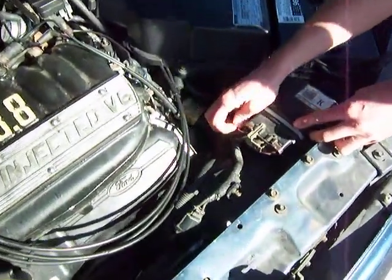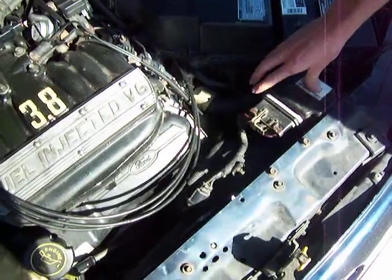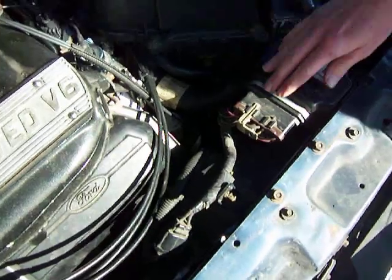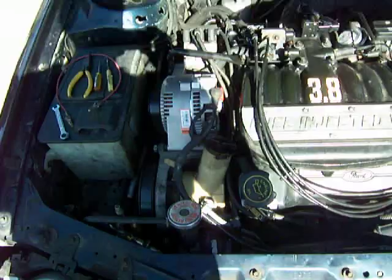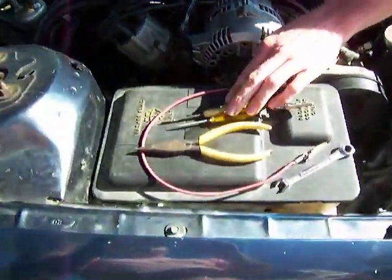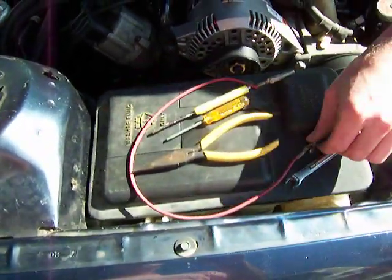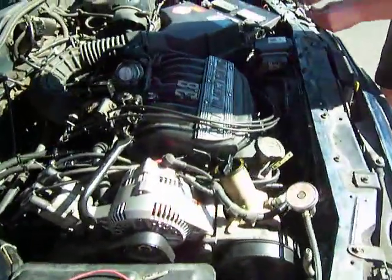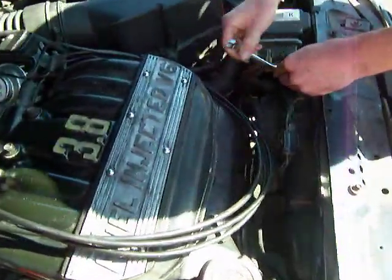To check this out, the power wire for the fuel pump should be a pink with a black stripe wire, which is this one right here. If you're in an emergency situation and need to bypass this, you're going to need some tools: two electrical screwdrivers with flat blades, needle nose pliers, a jumper wire, and an eight millimeter gear wrench or socket.